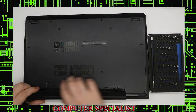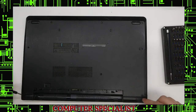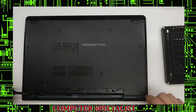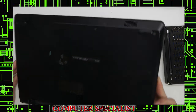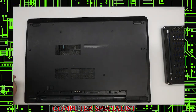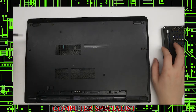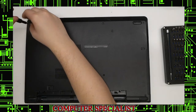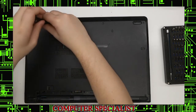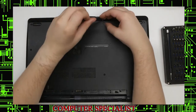To start getting that replaced, we're going to need to take out the battery. We have some bottom screws here. You can see that the two screws for the hinges on the bottom are missing — likely the posts underneath are actually broken, or they've just come loose. We'll see when we open it up. So we have nine screws on the bottom, and we'll start by taking those out. We do have generic laptop screws for other laptops, and it looks like we'll need to use those today to replace the missing screws.